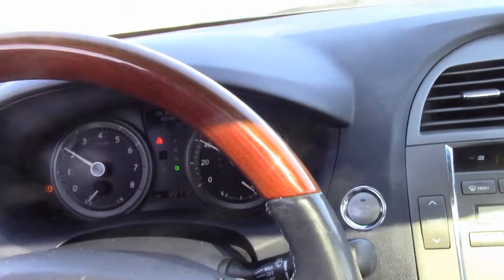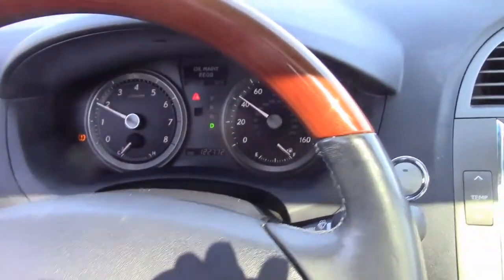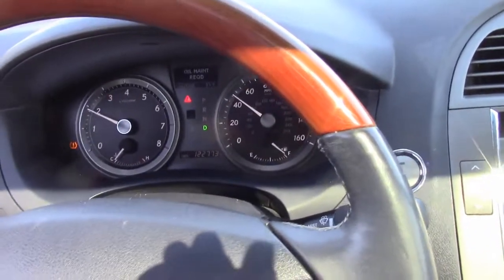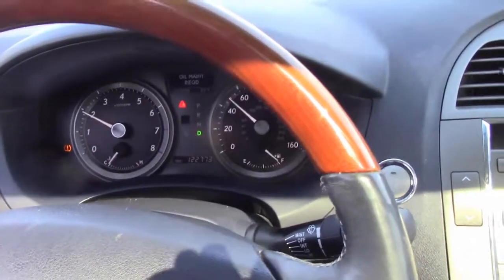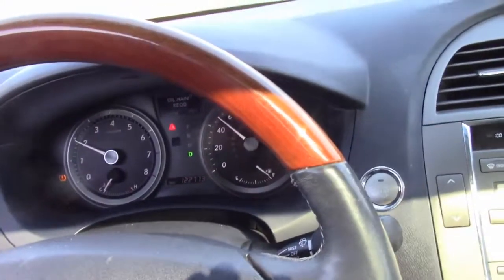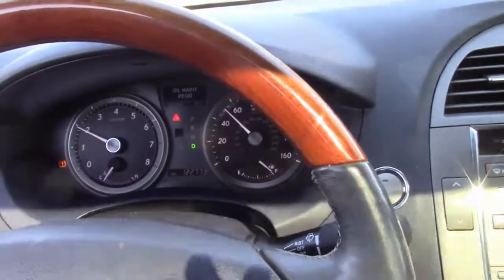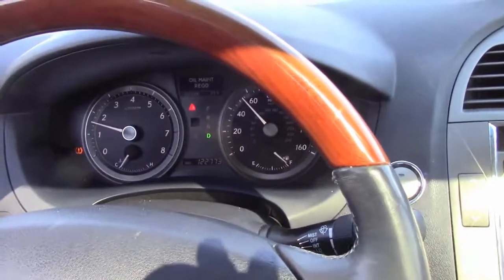and then we will reach out and touch the wheels. And if they're not warm or they're not hot, if you did any amount of braking at all, they'll get warm. But if they're not hot, then chances are your calipers aren't sticking. The older and crummier car you're working on, the longer it's going to take for you to have confidence that the calipers aren't sticking. But this is a good way to do it.